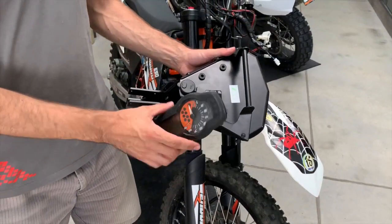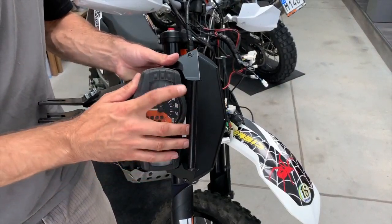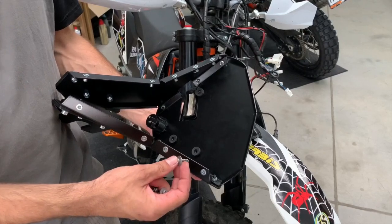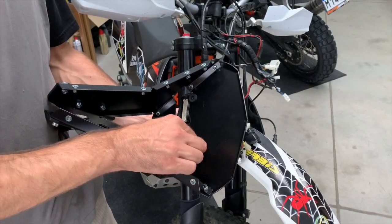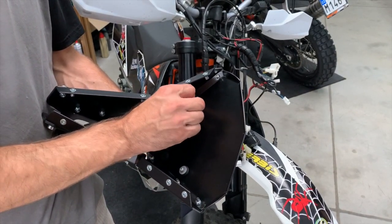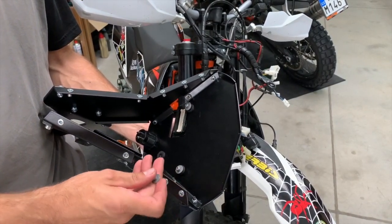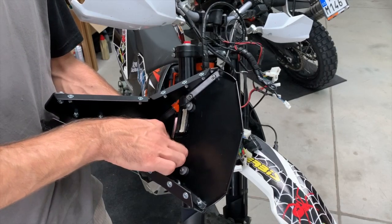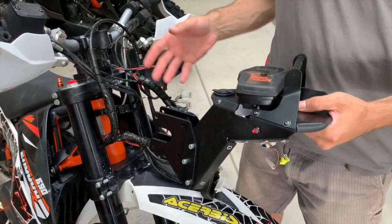Now you take the original speedo, and you insert it carefully into the grommets. Now you find the original bolts you have from the speedo, and you carefully tighten the speedo. The speedo is plastic, and you are tightening into the plastic, so be very careful with the threads. Guys, at this stage you have the tower ready to be mounted on the bike.